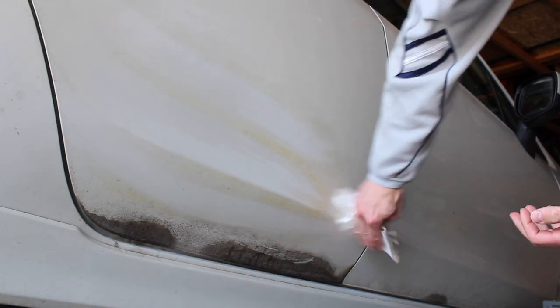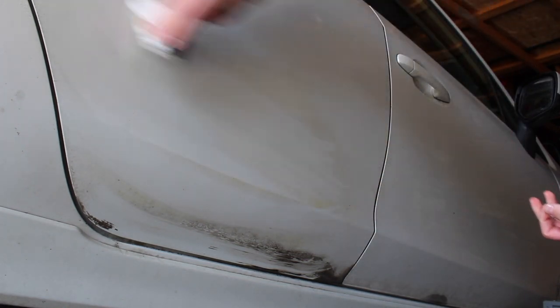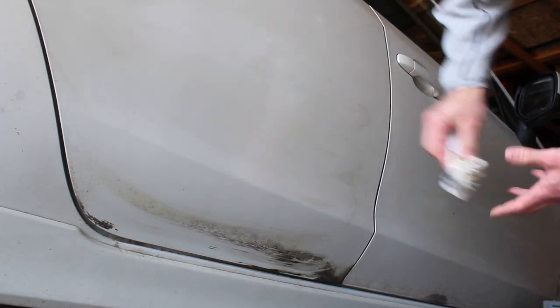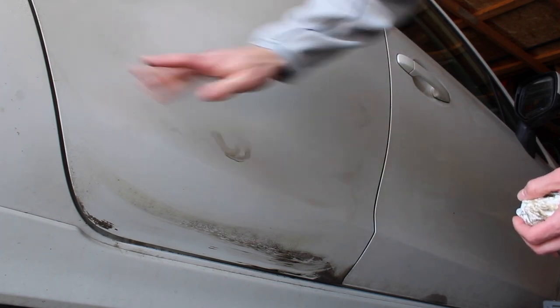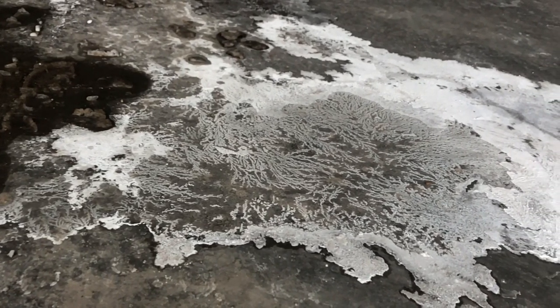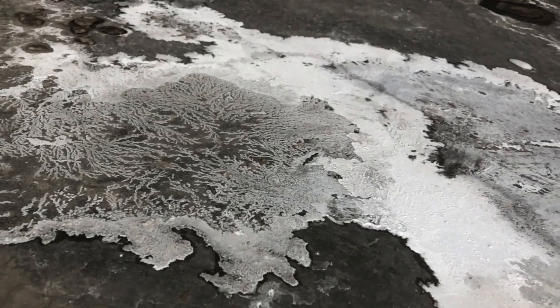When you spray this, you don't have to do a perfect job because it self-heals and covers the spots you missed. The other really nice thing is it heals over rock chips. If you use paint or an undercoating that hardens into a hard wax or rubberized type, rocks that chip those leave them permanently compromised — unless you go under there and manually touch them up, they're susceptible to moisture. With Fluid Film, if a rock hits it and takes some off, it'll creep back and cover those spots again. It's self-healing, which is really awesome.